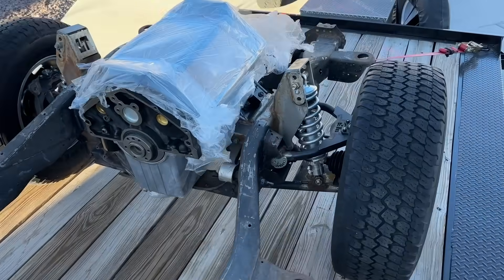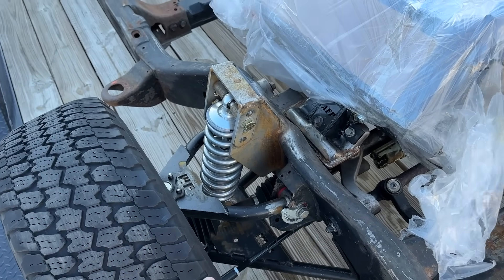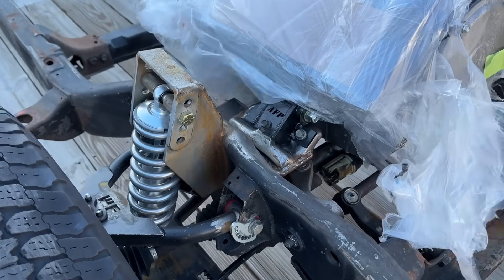Up front, of course, the motor. We've got some custom coilover stuff going on. I originally purchased these as a kit and did a bunch of modifications on the control arms. It has the aluminum spindle from a 2013 truck, and I built all those spring mounts myself. I just kind of wanted to make this the best possible four-wheel drive drag truck I could make. The goal is to be deep into the 9s, possibly 8s. The truck that goes on this chassis is going to be quite a bit more race-oriented compared to the ugly truck, which is a street truck with the full interior. The new truck is going to be gutted and as light as possible, because weight is the enemy of speed.